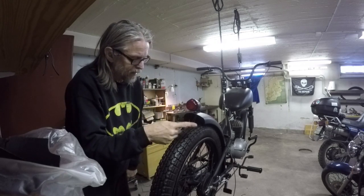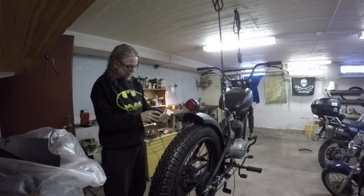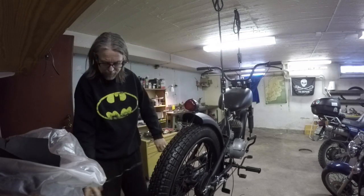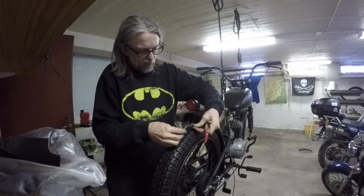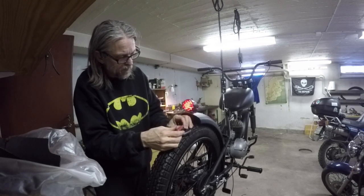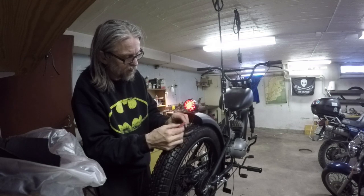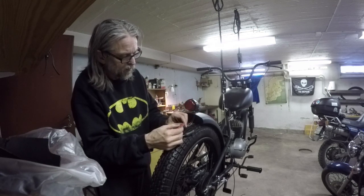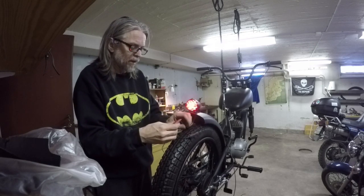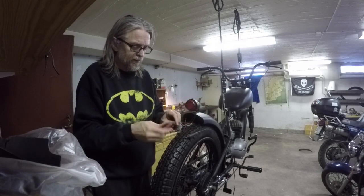Alright, we're about to test here which one is which. I'm guessing this is the earth, so I have my charger switched to six volts. We put the earth there on the minus. Guessing that's the right one — and here should then be the taillight. Testing the other way around, you see there's no difference, which means this is the taillight and this is the brake light.